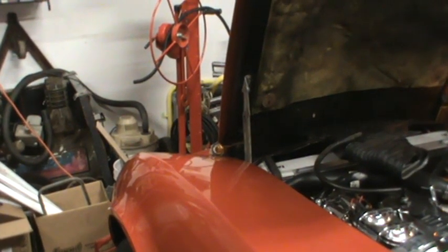But you notice what didn't happen? The light on the other side didn't come on. I'll try the turn signal light. That's not working. I'm going to turn off the parking lights. And I think I'm going to get the slow blink on the turn signal. And yes, I did. So, the problem has moved from the passenger side to the driver's side. How did that happen? Turn these lights off just because there's no point in having them on.